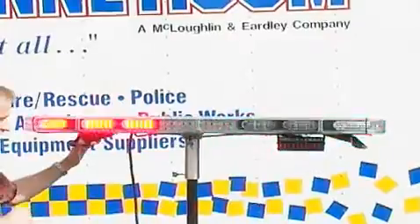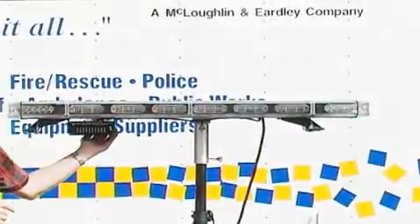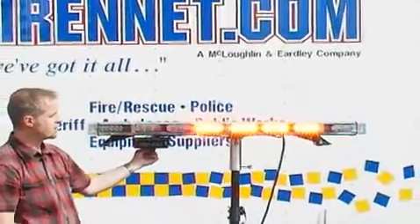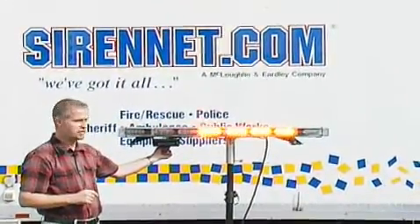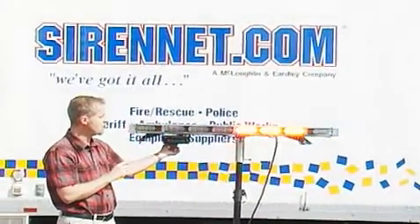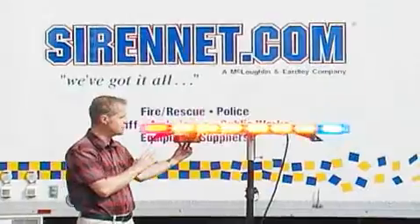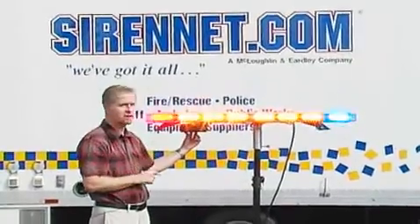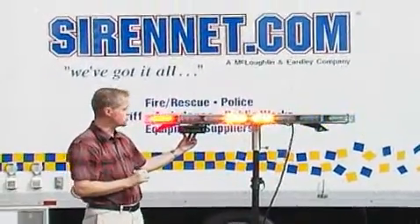The back of the bar — I'm going to spin it around again, it's not a helicopter, just a display stand. At the back of the bar, as I endeavor to switch it on blindfolded — there we go. You can see the red and blue configuration, and you can throw in a little amber as well. So you've got red and blue, or you can have amber in the bar too. Three different color options are available in the rear of the light bar depending on how you want to set it up. A standard traffic arrow function is also available, which has been part of the Liberty since it first started. The big factor about this particular bar is you can actually have different colors in the same module housing — a tremendous advantage with the 2010 bar.